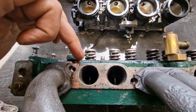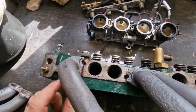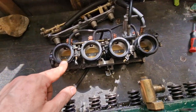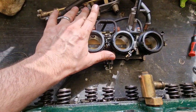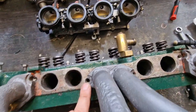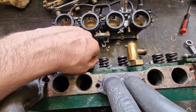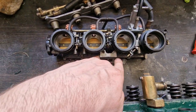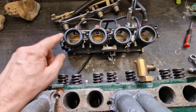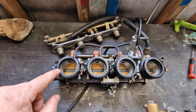I need to come out from here not only at an angle upwards, but this one goes slightly to the left and this one slightly to the right. There are two ways to mount these: I can leave them as they are and keep the rail standard, but that means making a more complex manifold and paying attention to the angles and bolt clearance. Or I can split the bodies here, separating one and two from three and four, which is what I think I'll do. Let's jump onto the laptop, get some designs made, and then come back.